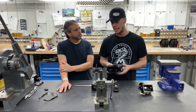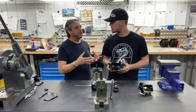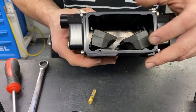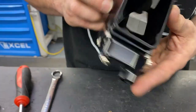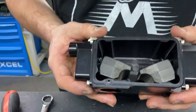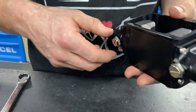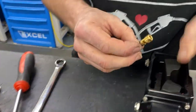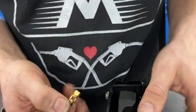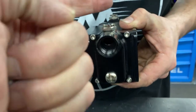Let me bring the camera down for a close-up. Here it is — dual fuel floats. So there are two separate needle and seats and two separate floats. Here's your needle and seat; there is a window in this needle and seat for fuel to flow through, and it is very important in this bowl that that window lines up to the fuel opening. We only set these floats in half-turn increments — you do not want to put the needle and seat in with the window off, as it will absolutely restrict fuel flow.